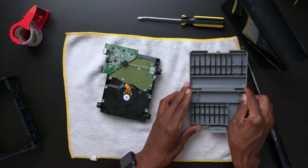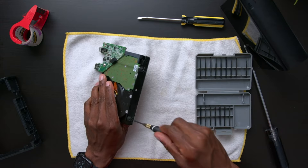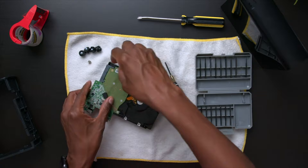You need to have a kit like this that has all types of different hex keys as well as flatheads. I found the right one — to be honest, it's not really labeled here so I can't tell you which one it is, but with this kit you can find the right one. We're just going to go ahead and unscrew that. That's just a regular Phillips. This is a little plastic piece you need to pull off, and then it needs to slide off the SATA connection right there.